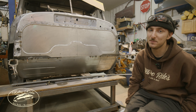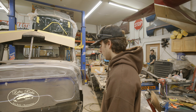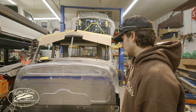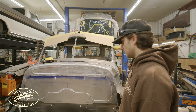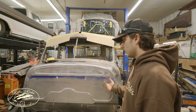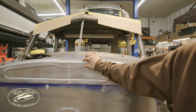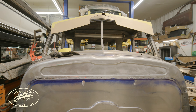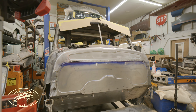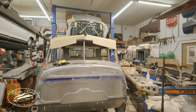That is what I've been up to. A little update on the 47 — I got the cowl piece welded and put in. You guys don't have a video of the process of that, but it was pretty similar to this. Just threw it on the bead roller and drew up a design. Trying to keep the gap the same around this to make it look a little better. This is where I'm at so far. Now to figure out where to go next, so stay tuned.